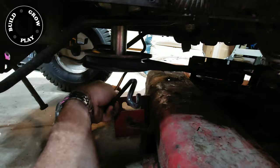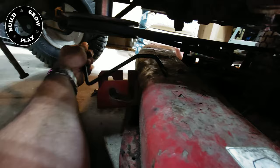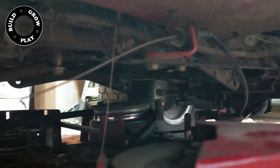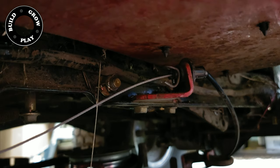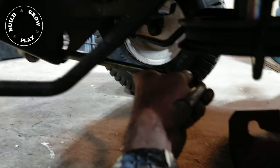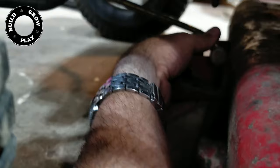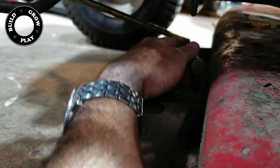Grab the tensioner component, stick it back in its appropriate holes. We're all hooked up from there through to there now. I actually lost the pin of that and just made it out of a piece of plain fencing wire. We re-hook up the front tensioner. It may require a bit of deck pulling backwards and forwards. That's why it's best to do this bit first, because once you've clipped it in the back, there's no going back.